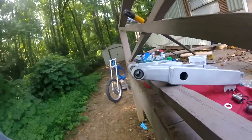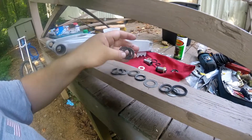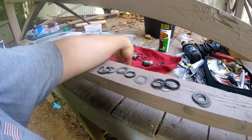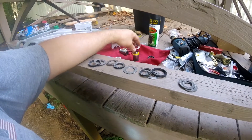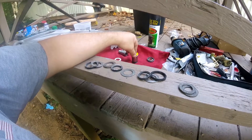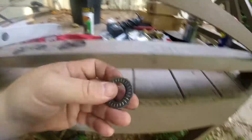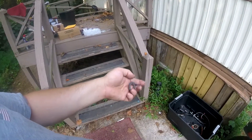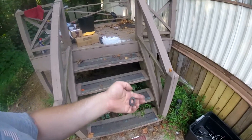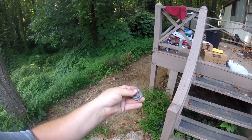Let's get these knocked out. Look what came out of here. We got some radial bearings from factory Suzuki parts. And this cheap bearing kit I bought just has a plastic coated greasable thrust base. I'm going to get rid of those and not use those. I'm instead going to use these. I got to get them all cleaned up because they got sand blasted from the outside. They didn't take a direct hit but they got blasted from the inside through, so there's sand all over them. So I'm going to clean these up real good and grease these and use these. I'd rather have these than those cheap little thrust plates. It's going to be a bear to clean them up but I think it's worth it.